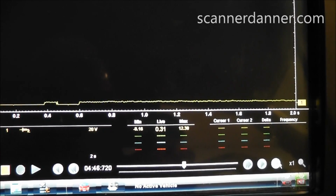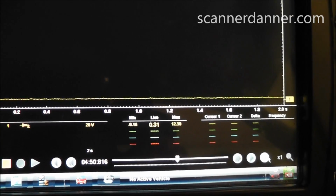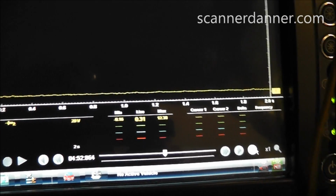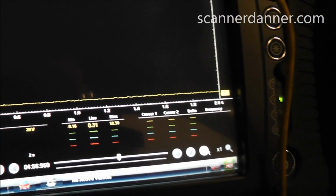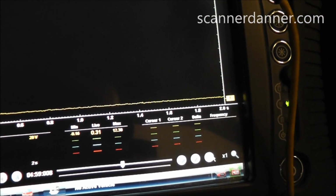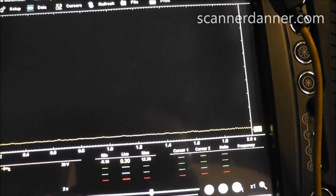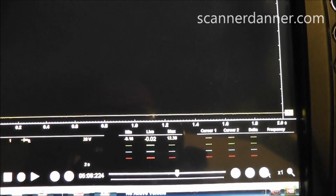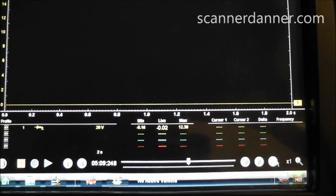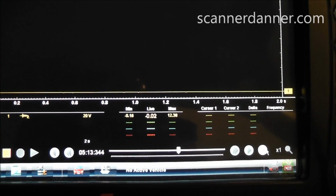So I'm taking my yellow lead off, and you see all the noise that's in that pattern now that you didn't see a second ago. The other thing you can do is shake your lead, which increases that noise. And when you connect to the circuit, all that's going to go away. Watch, I'll connect back up to it again. So you see the difference between a good ground and no connection is clearly visible. So that is a good ground.